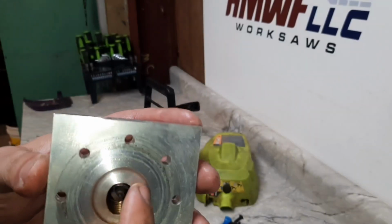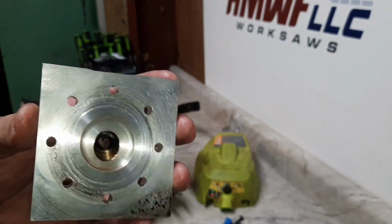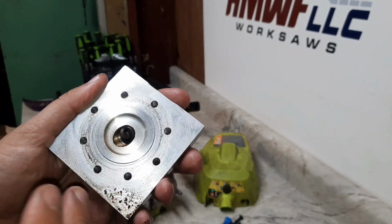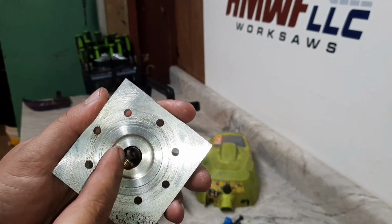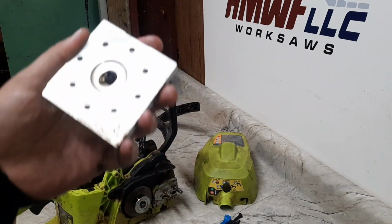But this is pretty much a flat chamber with a nice radius in the side and then the squish band. This was all done by eye. Squish came out right at 23 thousandths. I had a ground carbide tool that had a nice radius on it, so I just did a flat roof into the radius and then a flat squish band. Head in the lathe, had to get it done.